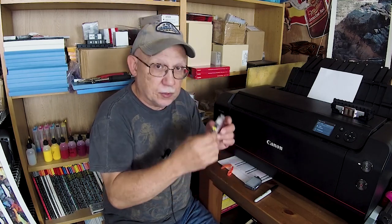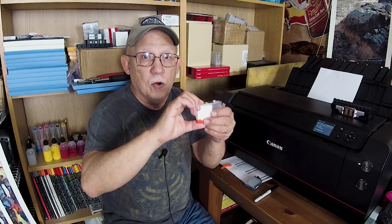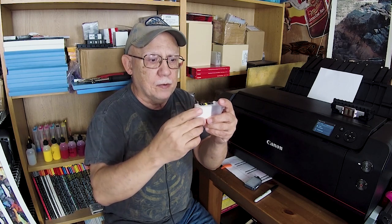You may actually swap photo magenta for magenta and vice versa, putting it in the wrong cartridge — which means you'd have to flush that cartridge. The same thing can happen with your cyans: photo cyan and regular cyan are two different strengths. Same with your grays and black. All of this will require flushing. What happened here was a yellow cartridge just like this one — it had a clip put on it, either the original or possibly a third-party clip — and as they refilled it with yellow, they noticed green ink permeating the sponge.